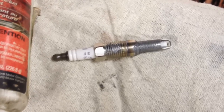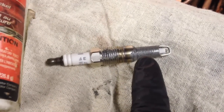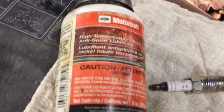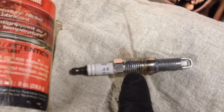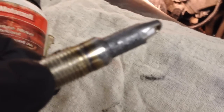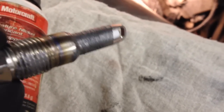Now what Ford has us doing to prevent this in the future — from that tip sticking in there — is to apply high-temperature nickel anti-seize all the way around from Ford. Put some on the threads going into the head. This is supposed to prevent it in the future. Put a light coat on there all the way around; that's more than enough.